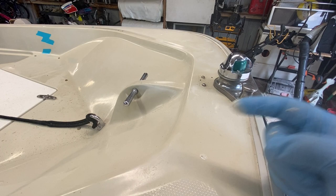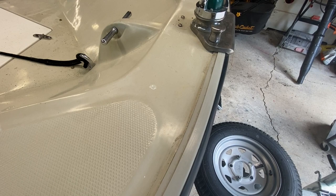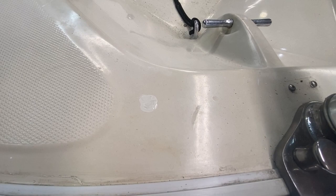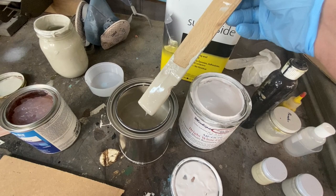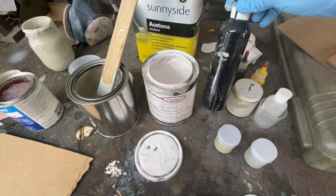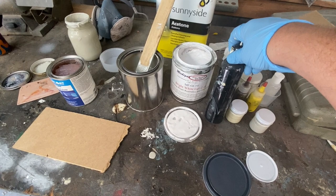Right now the mix looks a little light in its liquid stage — it's not catalyzed — but that gives me a good look at the color. I think once it cures it's going to be pretty darn close. A lot of people don't realize what desert tan is. Desert tan is a lot more of a putty color than a tan — it's a lot more gray than it is brown. I can't give you guys a true formula; it really is done by guessing for each individual hull. I start with black to try and get the right value — this stuff is voodoo. Use it sparingly, whip it in, get the color going, take that white down to gray, and then add in the brown and yellow to get to that putty color consistency.